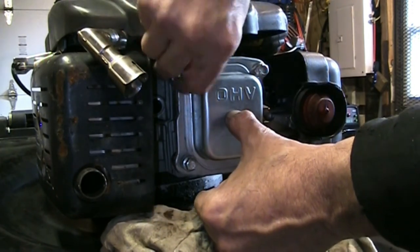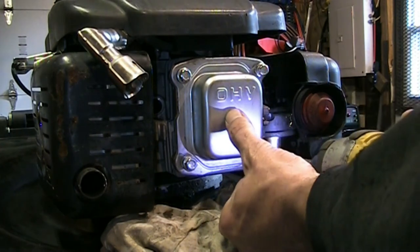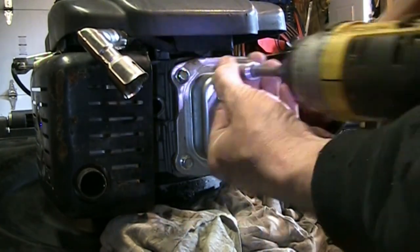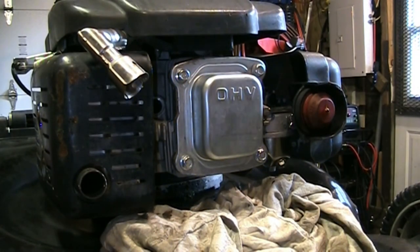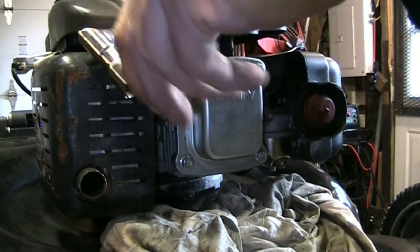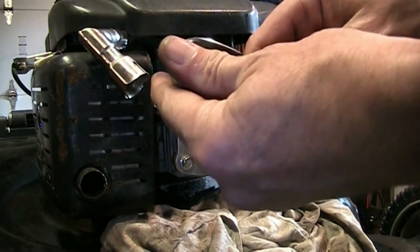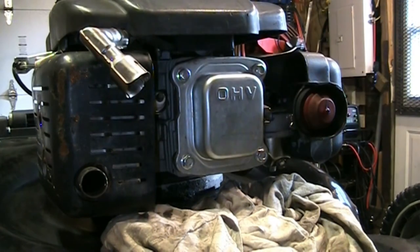Run these down — it's just a quarter-inch basically a screwdriver. Tight enough. We know our valves are set, all that good stuff is in great working order. We'll fire that new spark plug back in there. I don't think there are many hours on this machine — otherwise those valves would be a lot more out of spec. Don't go too tight or you'll strip the threads out of the head.